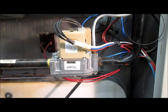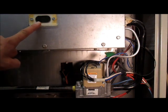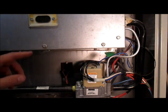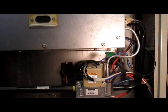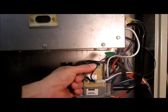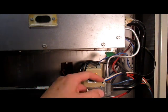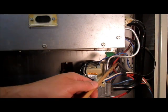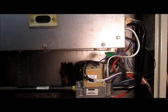This is the gas valve and it should make a nice click sound when it comes on. Once the exhaust fan gets up to speed, you can look in this little window right here and see the igniter glow red hot. After that, the gas should turn on. If you don't see roaring flames in the window within about 15 seconds after you see the igniter glow, then most likely this gas solenoid is broken. If you want to verify before you replace the part, you'll need to peel back these four wires and put a voltmeter across them. The white wire is common, and you should get 24 volts from the black wire, which is the source wire, and from the blue wire, which goes back to this pressure detector right here. I'm getting the proper voltages, but this thing is not kicking on.